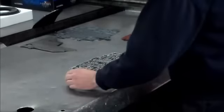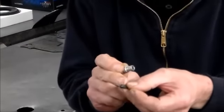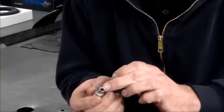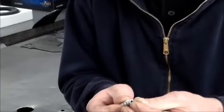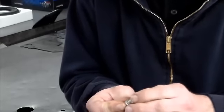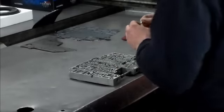All right, and this, see if I can get it out, is the boost valve. Okay, you want to look at this valve for wear. You want to look inside here. Make sure there's no wear. Sonnax also sells a replacement. I find these are pretty good, but they do wear out. If Sonnax makes it, then it can be an issue.